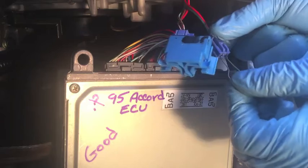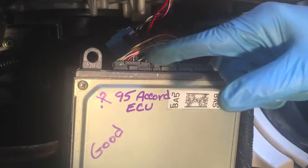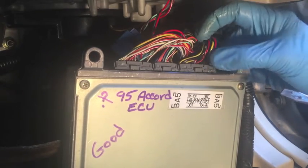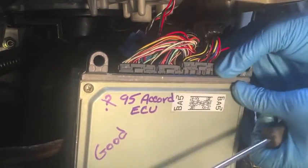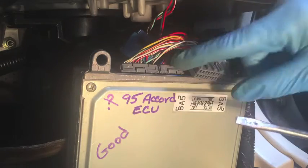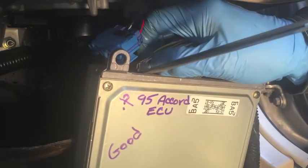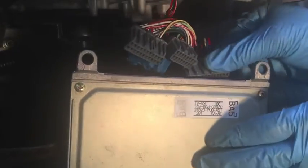Now that we're finished checking the trouble code, we can take this paper clip out and plug it back in where it was. To get the wiring harnesses off the ECU there are three connections, each with a clip right in the center. You need to press down on that clip while you pull the connector out. The way I do it: I push in on the clip, take a flathead screwdriver and pry the connection out a little bit, then grab the plastic and pull it out the rest of the way — so I'm not pulling on the wires and risking pulling one out. To put the good ECU in, these connections are different sizes and only go in one way, so just push them in till they click.